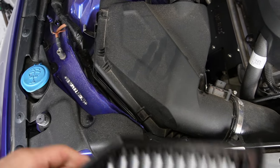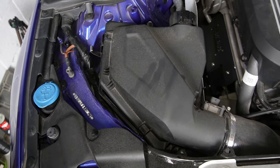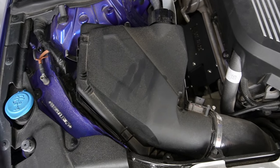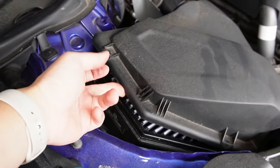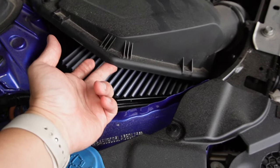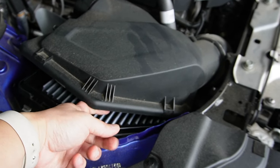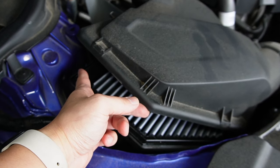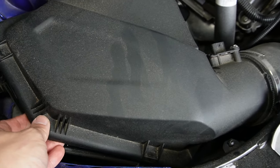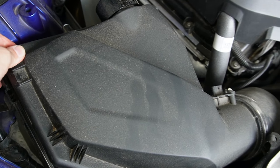You want to mock up and see how your stock intake box is going to look. You'll see the slanted line — the intake panel filter element is going to sit like that. It's really hard to do one-handed, so with the magic of editing, I'll put it in and go to the next shot. The new one's back in. If you have a hard time sliding it in, I'd advise sliding your filter from the wider opening side to make it easier. Make sure it's sitting tight because we'll have to seal the intake box.